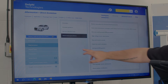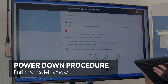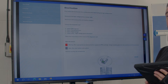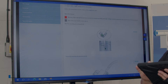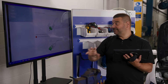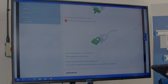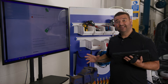Moving into Delphi's technical VTI, we can see we've come straight into maintenance procedures and here we have high voltage circuit deactivation, so we select that. It gives us a base warning first, checking the gloves to make sure we're safe — we've already done that. Moving forward to deactivation, it says to make sure safety barriers are in place. If there were other people in the workshop we'd definitely need to do that. We connect the diagnostic tool and follow the instructions: move to the plug on the back of the bulkhead within the engine bay, release the clip manually, power down with the diagnostic tool connected. When we disconnect this we should see the voltage drop from 300-plus volts all the way down to less than 10 volts. We'll then padlock it off to prevent anybody from accidentally re-engaging the system.